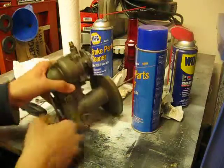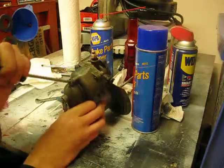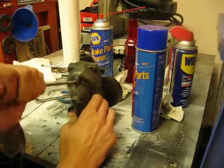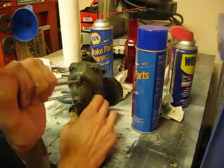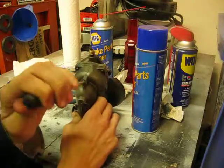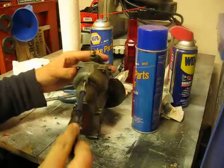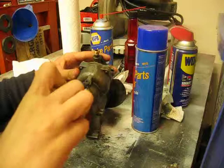The next thing we need to do is screw back in our main jet by way of this brass nut at the end here. So just take my larger screwdriver. Like I said, these last few and first few rotations are fairly difficult, but then once it gets easier, you can switch over to a smaller screwdriver, such as this one, about a 3/8 inch head, and just work that back in.